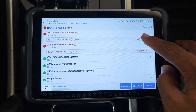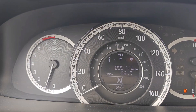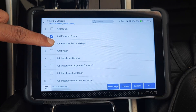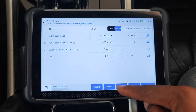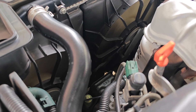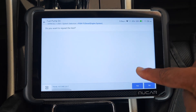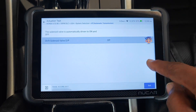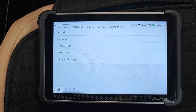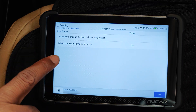These are legacy codes from the last time I checked engine compression. For the ABS and EPS systems, even after codes are gone you typically need to reset those ECMs to fully clear the codes from memory — and as you can see, there's no check engine light on the dash. Going into system selection and the ECM, live data has over 200 PIDs and you can graph a maximum of 4 PIDs at any time. This is a bi-directional scanner: I was able to actuate the radiator fans, the AC compressor clutch, the fuel pump, and run tests for transmission solenoids under the transmission control module. Since this tool also supports ECU coding, I moved over to a Toyota RAV4 and was able to configure several ECUs — for example, altering settings for daytime running lights and door-chime or seat-belt chimes.